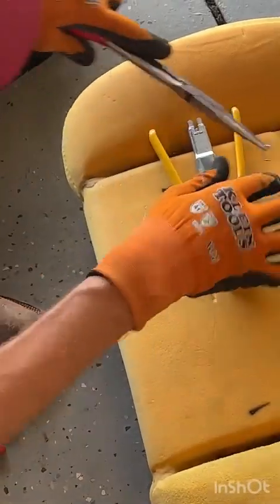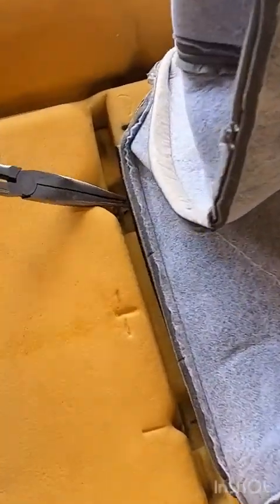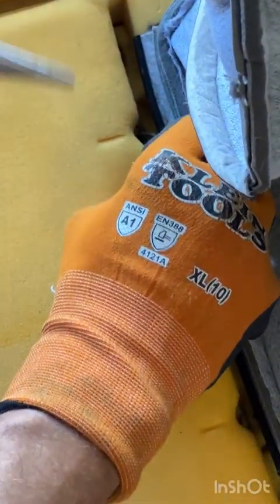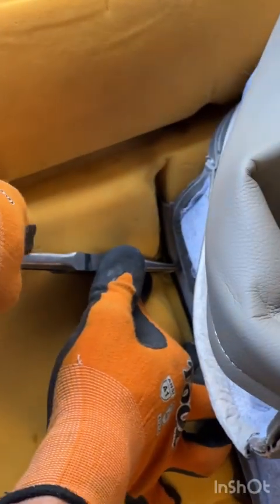your pliers and put one down, hook it over the top. Oh, and you also want to check your spacing left to right. I did not right there, so I'm actually gonna push this one off. Gonna get this guy kind of evenly spaced in the groove here. And give it a grab. Grab your hog ring. Hook it over the top. And then you can, if you like your spacing, which I do now, go ahead and just pinch it all the way closed.